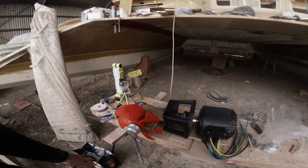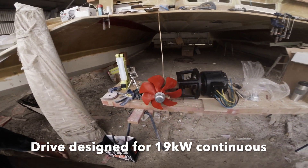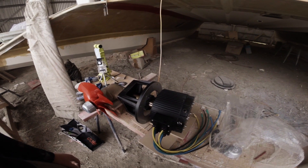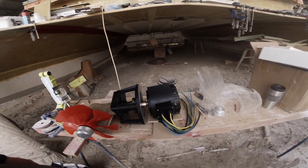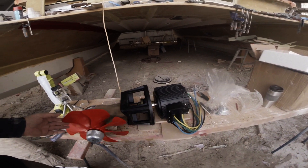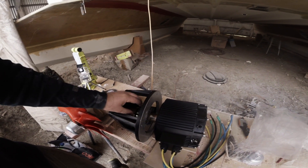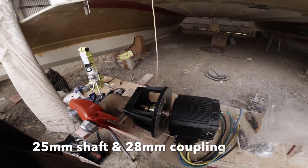I've got to see if it works or not, but it ought to. This drive is designed for 19 horsepower, and this motor is a 10 kilowatt brushless electric motor with a 15 kilowatt peak — so I'd say this is a pretty decent match. I have a bit of fabrication to do to ensure the drive coupling works, because the shaft diameter of the motor is different to that of the drive coupling, so I have to fix that.